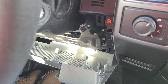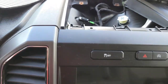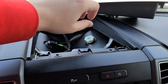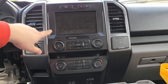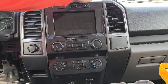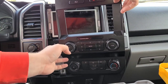The other camera is kind of dark, so if that footage comes out dark, I'm sorry. Basically, we pulled this off — just a couple clips on there, some came out a little hard being a newer vehicle, never been pulled out before. Then up here we had this panel. There's two bolts — one there, one there — and that pops out. You've got two more: one right here, one right there. Now we need to take this entire panel off. Since we already took those two screws out of the top, this will pretty much just pull off, though it's kind of hard. We're going to slide this off to the side a little — we don't need a lot of room.